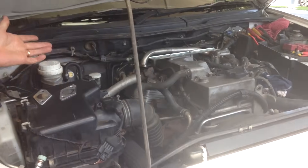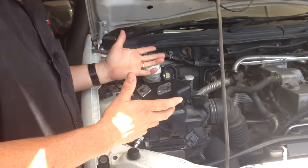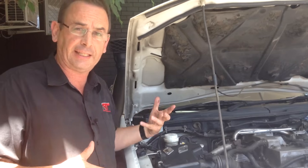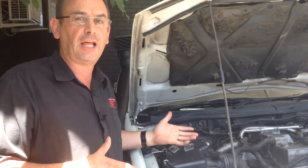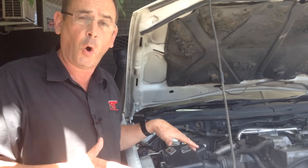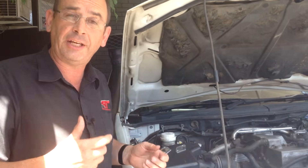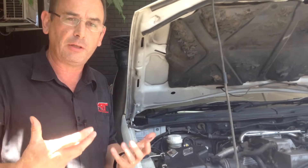This package comes in a 3.2, 2.5, and the new 2.4, but they all share a fairly common problem, which is a bit of a dirty secret — the buildup of soot in the inlet manifold. This is created by the exhaust gas recirculation coming out of the exhaust, through the EGR valve, into the inlet manifold where it mixes with crankcase blow-by oil out of the sump. It forms this horrible sooty, scummy substance that looks like Vegemite on the inlet manifold, and it starts choking the engine, restricting power, and causing other supplementary problems.